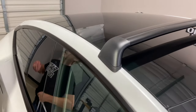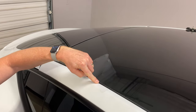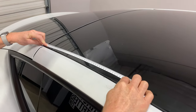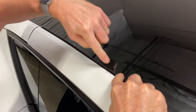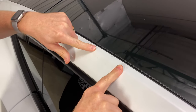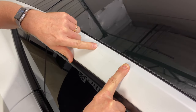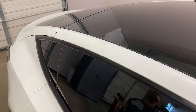The next measurement is from the back of the glass to your hard point, and so you measure from there to there to help identify the exact location. You may or may not be able to see it, but there's a line, a line, and an arrow. When you apply your 3M adhesive to protect the paint surface, there's also an arrow to help further identify that location. Okay, so next step, let's go ahead and grab the load bar and the connection.